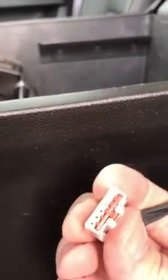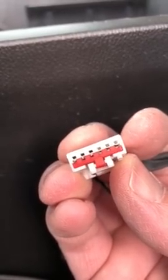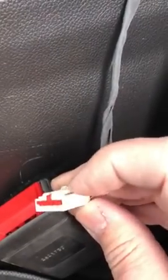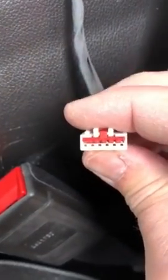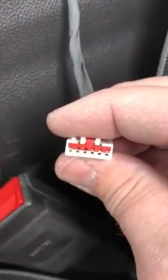All right, so this is the plug from your truck, and you can see that it is 6-pin. It has the same width as the new hole, but you also remember I showed you on the old unit that the top is shaped differently so it doesn't easily plug in. However, if you trim these plastic ears off each side of the top, on both sides, you'll notice that I left a little bit at the end to give it sort of a ramp up, so it would still have grip since it's not going to snap into the factory 2018 charger.